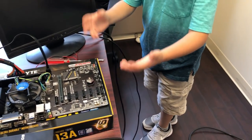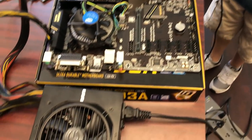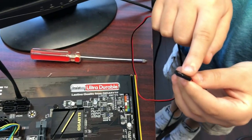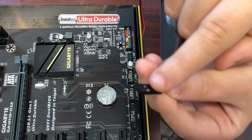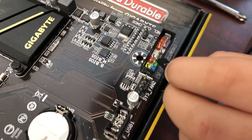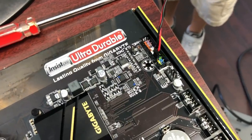There are two ways to power on a motherboard. The first way uses a small power switch connector — since we're not in a case, look for the arrow on one of the pins. The arrow goes above the middle piece, into the plus sign on this spot. Then push the button.